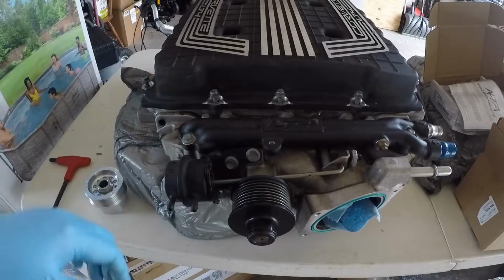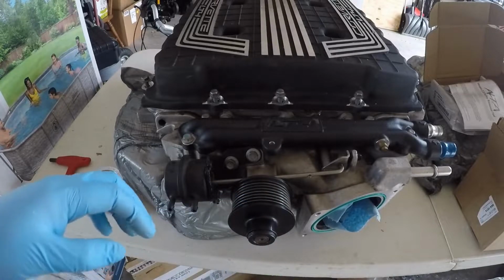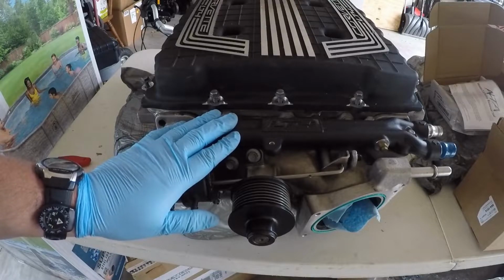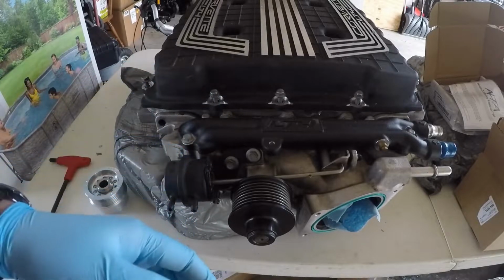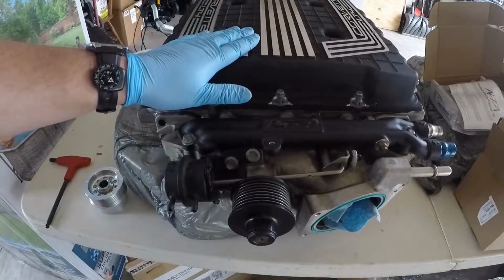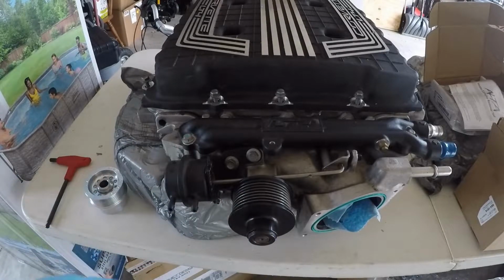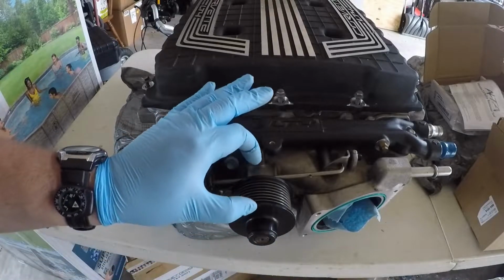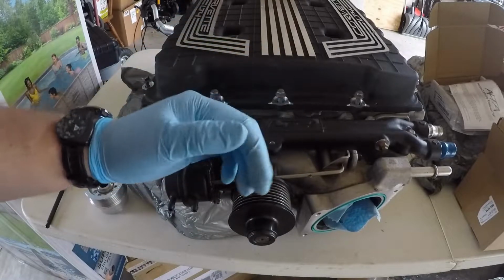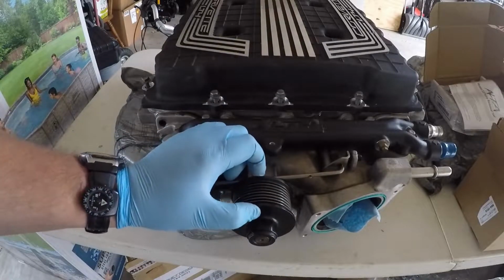So the purpose of this video is how to upgrade this pulley. There are a couple of challenges with this particular early model LT4 Supercharger that we've covered in other videos. Just as a recap, the big challenge is that I want to keep the lid design short, but also keep the alignment with my stock harmonic balancer using the ICT billet bracket for the hydro pulleys. We needed the early version of the LT4 that had the snout recessed in, with an offset that's more negative than the later versions of the Z06s and ZL1s.